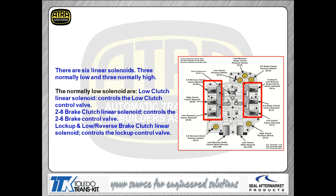So you cannot buy a solenoid at this point as an individual solenoid because, again, they're matched to the valve body by Jatco. You'll see some markings on the solenoids themselves that will denote those flow characteristics of the solenoid. Again, those are Jatco proprietary numbers. We don't have access to their information itself for figuring out what the flow rates of the solenoids actually are.